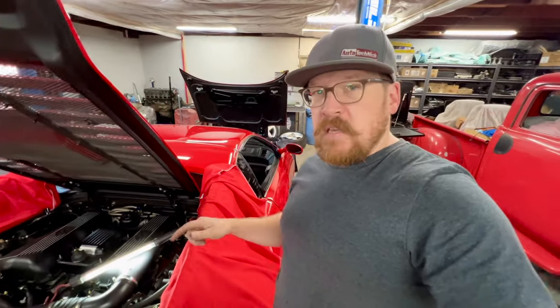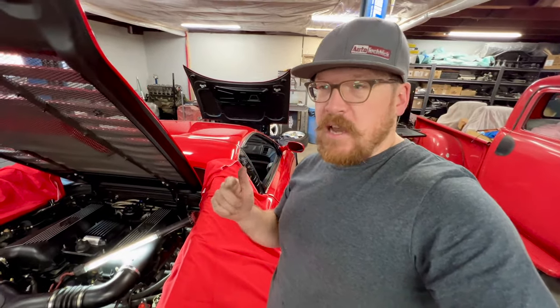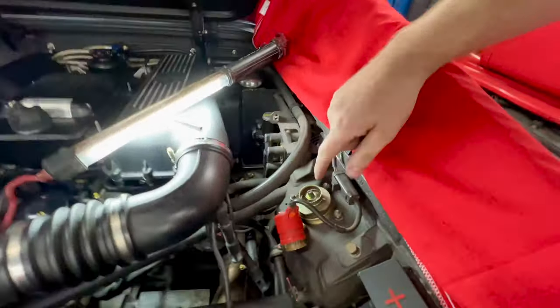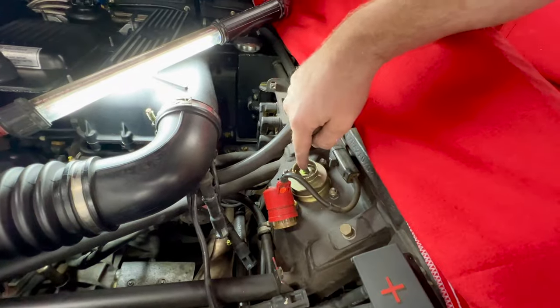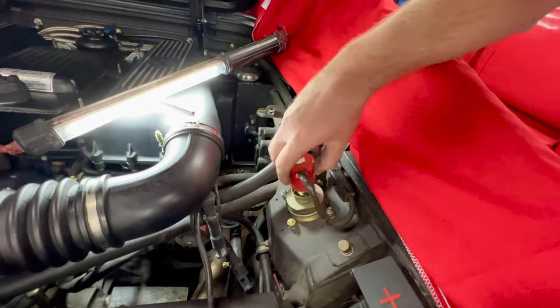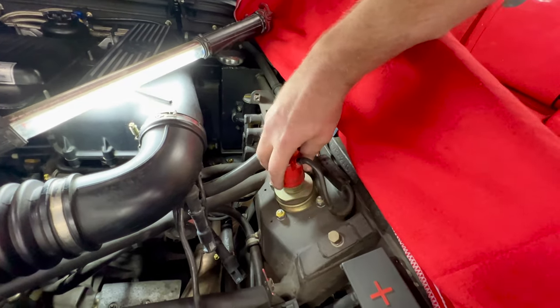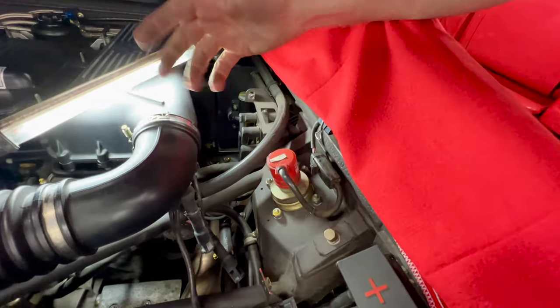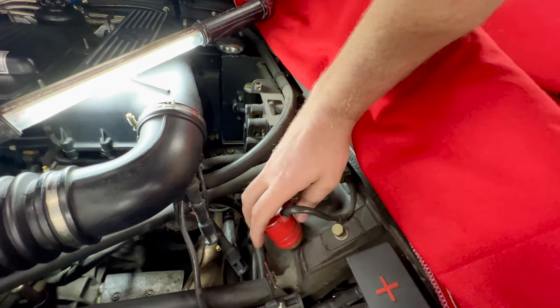So if you have a broken gear or a broken motor, it's just going to spin continuously in one direction and never stop, and that's going to set an error and fault and a warning light in the car. So because it does that self-calibration every time you turn the key on, you don't have to worry about how you index these back on when they go back together. You can put them on however you want. It's just going to recalibrate. You turn the key on, nothing to worry about.